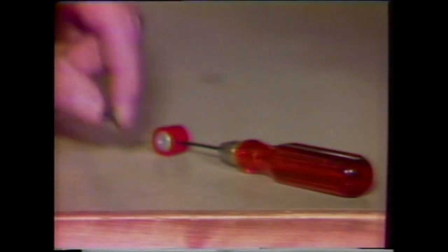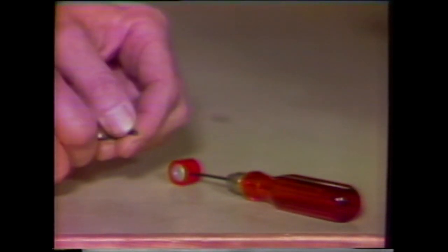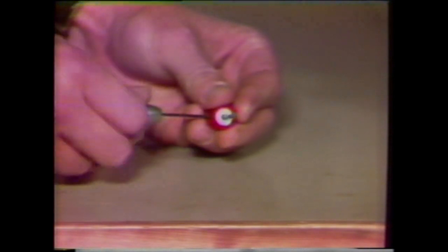One of the best tools to use when making vertical output board adjustments is a small tweaker. You make one by cutting off the bladed end of a regular tweaker and putting this piece into a small knob. Tighten down the set screw, and you have a handy little adjustment tool that's just right for small work areas.